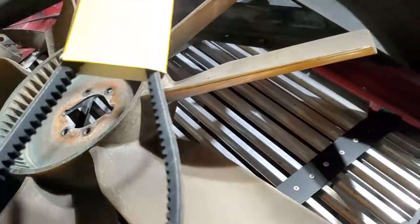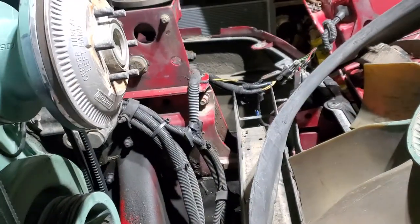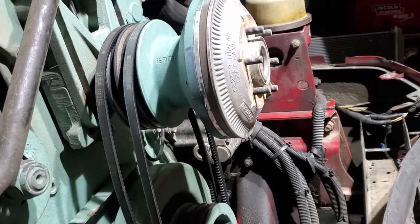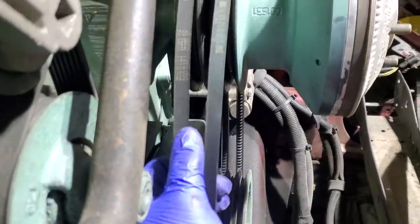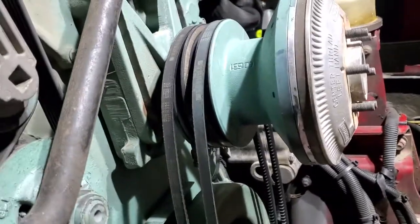Because there's no way that these new belts will fit over that. You might be able to fit it over — I didn't try it — but it's a lot easier just to do it this way. Being that we rebuilt this whole motor out of frame, it's got new everything on it. But one of my belts snapped. I could take a chance and just let them run, but I'm not. I might as well do all three right now.